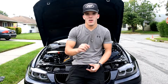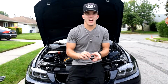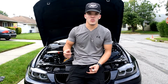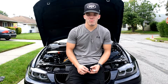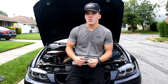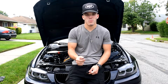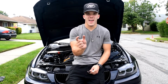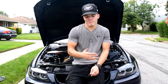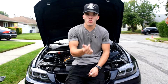All right, guys, that's pretty much it for the video. The stock PCV valve is out and the new one is in the car. Pretty basic procedure, just follow the steps as in the video. Once again, there's only one thing you have to change from the stock: you have to cut the burrs from the cap of the PCV valve. Besides that, it's pretty much easy. Just unscrew the fuel pump, unscrew the housing, and put in the new PCV valve.